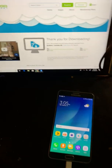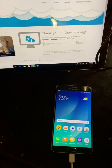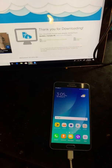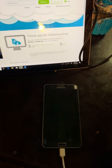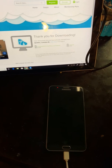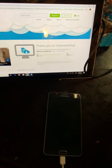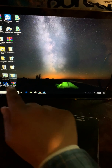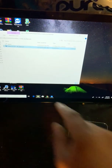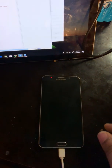In this video, we will show you guys how you can unlock a Samsung Galaxy Note 5 on the Sprint network to use it with a different carrier. What we need first is a tool — we will use a Z3X Box — and we will have to root the device. So first we're going to open the app and then put the phone into download mode.